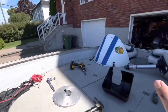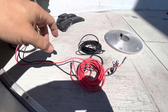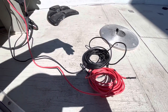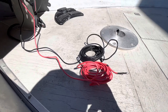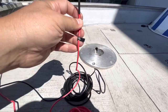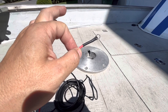Don't forget to pass the wire through the hole we made before putting the cover on. The next step is to pass the wires all the way to the back of the boat. Here's a trick: before passing the wires through the hole, you want to unroll them completely — you don't want to leave them rolled up, it'll just create problems. Unroll it completely, extend it, and when you're ready, grab the end and pull the whole wire. I'm going to cut the connector rings off and re-attach them at the end because there's little space and they might get in the way.